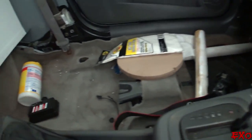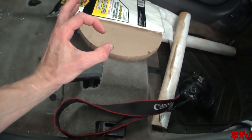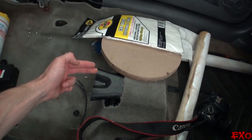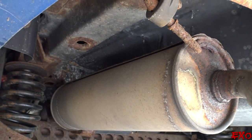Just underneath me there's a little hidden goodie. I went on Amazon and we're going to utilize this little bad boy just underneath our seats on both sides. There's an AC outlet or a heater outlet. We're going to put some Gorilla tape around this, and I ordered some hosing about this thick. Hopefully we're going to have a run on both sides of the vehicle. We might test it out and see if it works better with two on one side or two on the other, because unfortunately our muffler is right next to the amplifier — it's going to be generating tons of heat before we even turn our amps on. So hopefully this little trick right here will help eliminate a little bit of that heat.